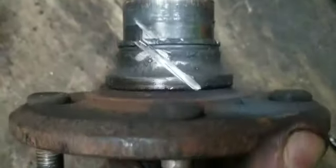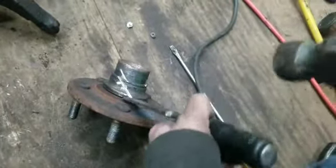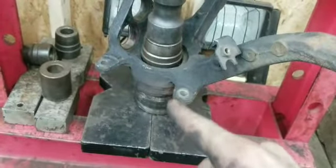Ah, there it is. Look. First whack. You can see it's completely away from the cut, and you can see that crack right there. It'll probably come off with just a flathead. Oh, come on, don't play me like that. I have to smack it off, and I don't want to show you guys. I've got you guys in between my knees right now. I'll be back. Again, I forgot to record when it was busting free, but the bearing's moving. I've got to readjust because it only has so much movement, but it did break free from the spindle.